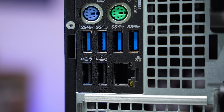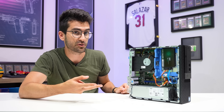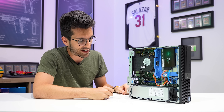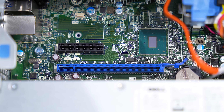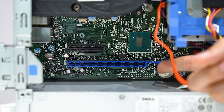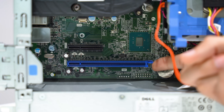It does have 16 gigs of DDR4, two 8-gig sticks apiece. They are pretty basic, but at least we get two. And speaking of two, we only get two PCIe slots. This is more like an ITX form factor, and those two slots are also smushed a bit, so you can't fit full-size graphics cards in here without using a Dremel or something crazy.